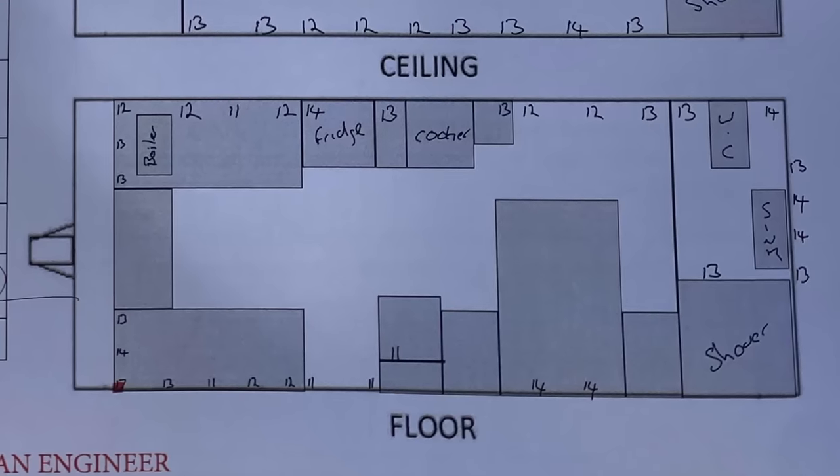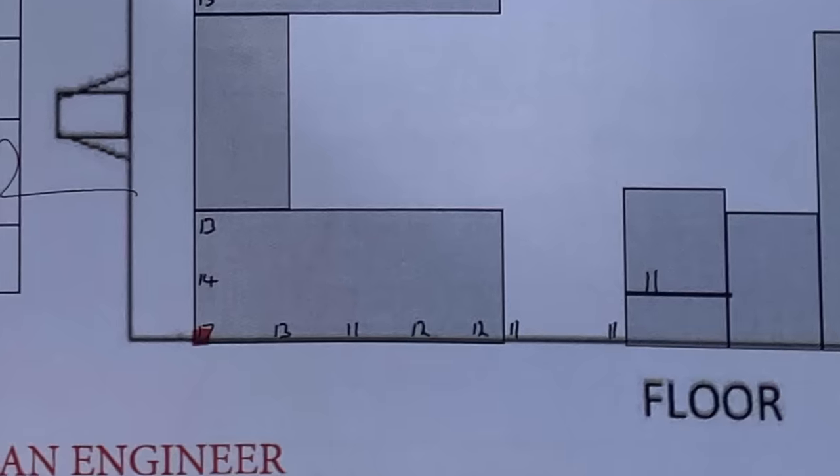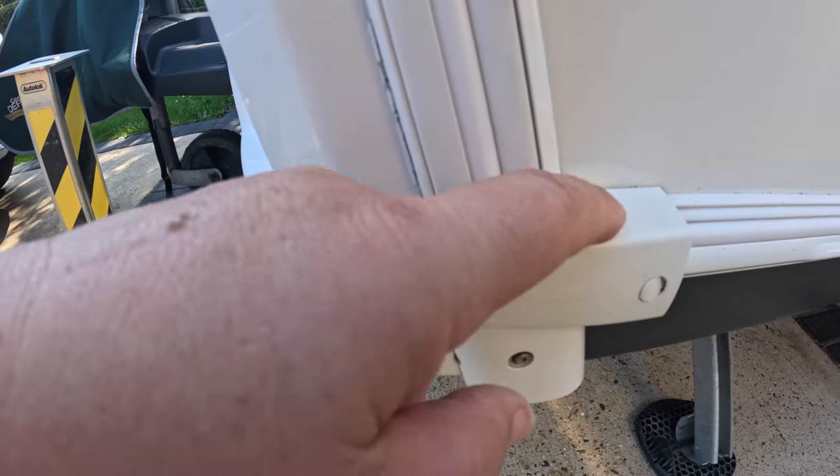I'll show you because I'm going to go over and do a repair job today. The readings are all well below about 15. The average reading is sort of 12, 13 and anything less than 20 is nothing to worry about. But just this one area was reading 17 where everything else was like 11, 12, 13. When he had a look, on the exterior of the van there's a little bracket which has got a crack in it and he suspects that potentially there could be a bit of moisture getting in there.